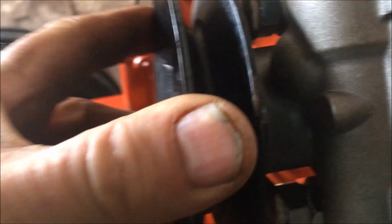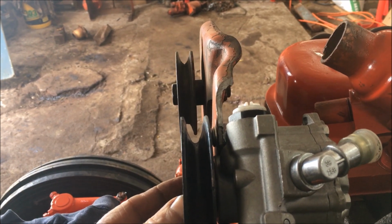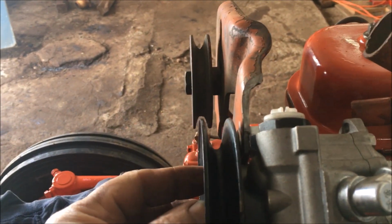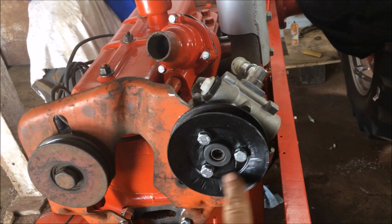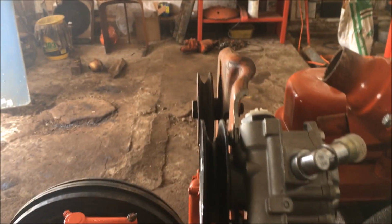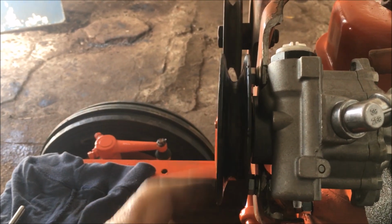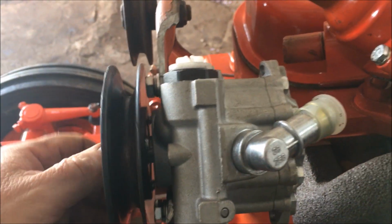And that's all right because putting the pulley there, it looks to my highly trained eyeball like we need to bring this out a little bit anyway to line it up. So we'll figure something else out. Okay, I've got the pump mounted to the bracket and the pulley bolted onto the pump. This time I used 2 3/8 nuts and 2 8mm washers for spacers. And according to my highly trained eyeball, I think we're lined up pretty darn good. V-belts are pretty forgiving anyway, but I think we're lined up pretty good. So there, we're bolted up.